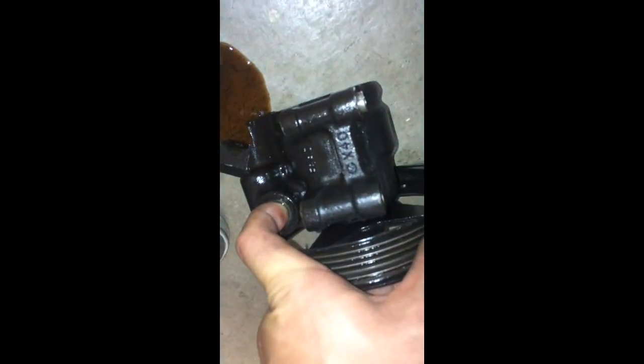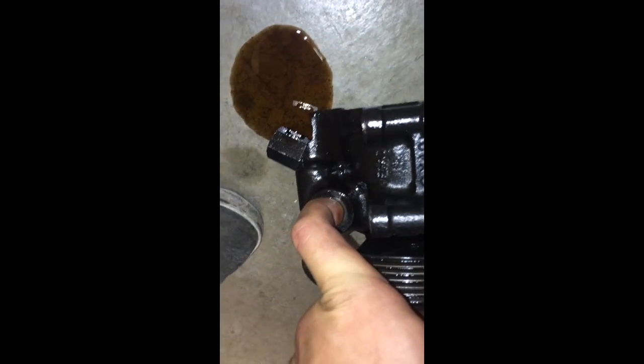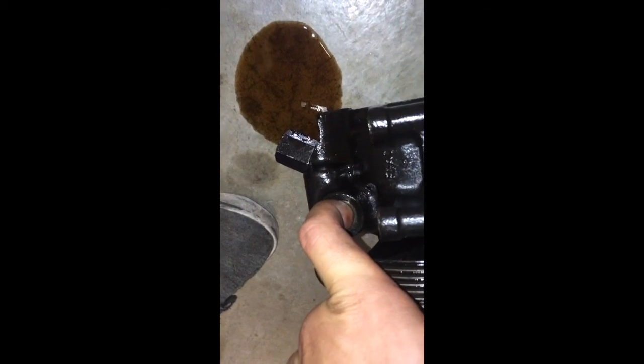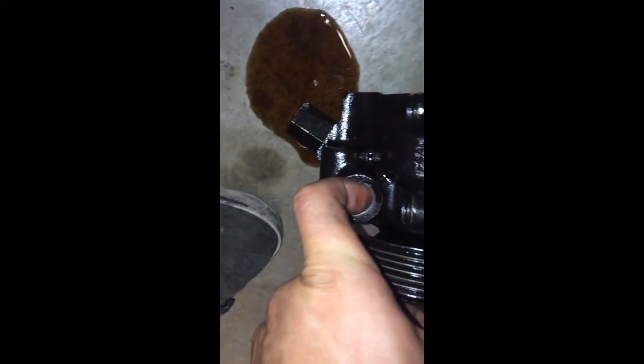So when you run into that problem, if you're unbolting it before you unbolt all the other ones, you're going to press the power steering pressure line out, and you're going to eventually crack it and break it. At AutoZone, because it happened to me, we got mine for, I think, 30, 40 bucks for the brand new line. So it wasn't bad, but it does set you back a little bit. So just keep that in mind.